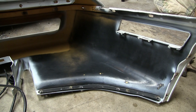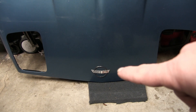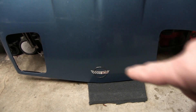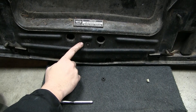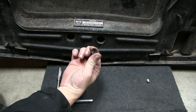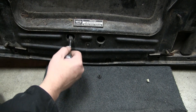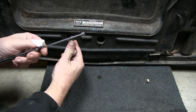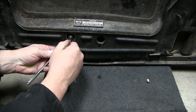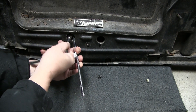To clean up the nose — and I think next I'm going to clean up the hood. I'm going to go ahead and take the emblem off the front of this salvage hood. In order to do so I've got to spin the hood around because there are a couple of nuts holding it on from the back side. In the very center there are these two holes where the little speed nuts are holding on the hood emblem — it's just a 10 millimeter. I'm going to take a magnet tool and just slip it on underneath just in case that drops out, so I can grab it with the magnet tool.